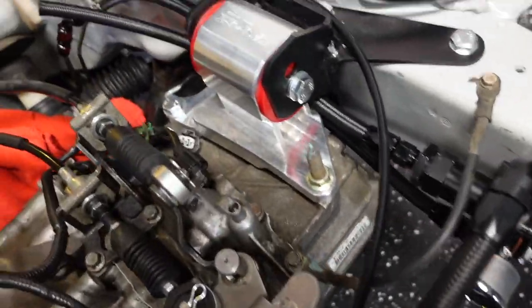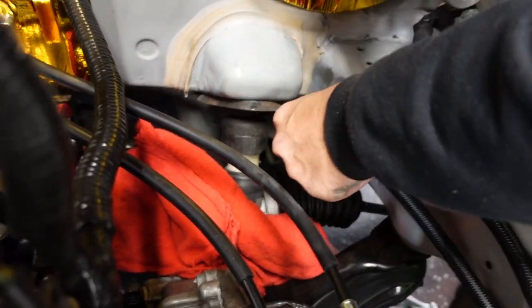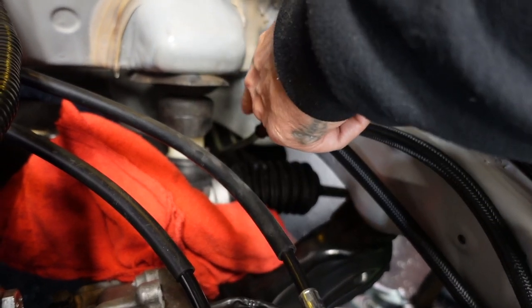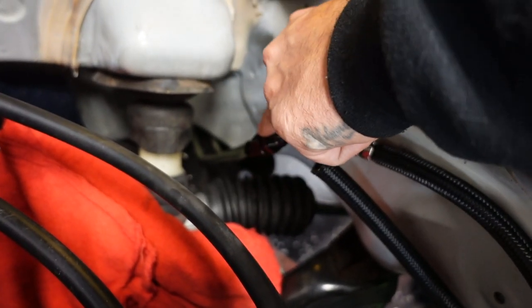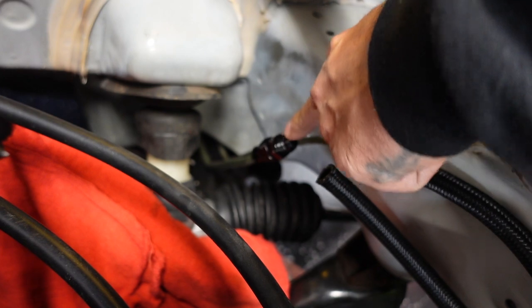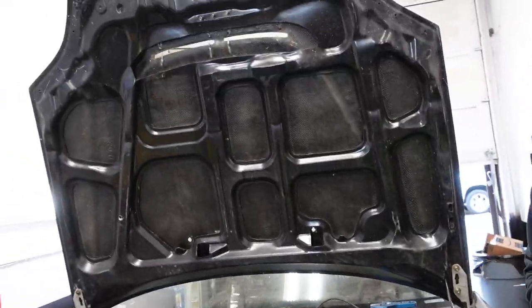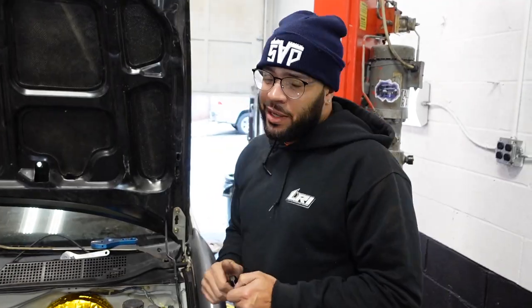But, yeah. You want to talk about that fitting that you put on there? Yeah, so on Project Driver we have this line clamped, and it's one of the things I hate the most about the car. So, we got a 5/16 to 6 AN. It's like a compression union, but that's not the size, guys. It came from Amazon in a little baggy.